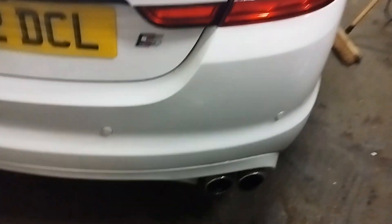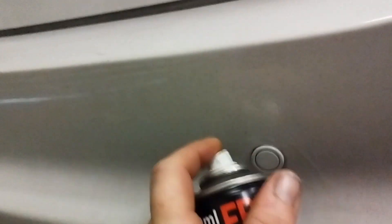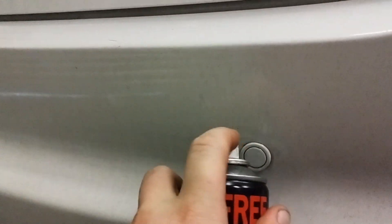So right inner — I would say is this one here. So we'll just spray it with some GT85, which is like WD-40, it's a water dispersant. We'll spray the sensor itself. I don't know if it's going to do anything, but we'll spray that and leave it on, see if it'll get any water out. It could be the connector, but this is not easy to get to under here.